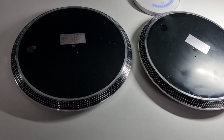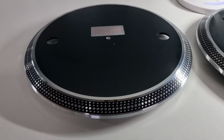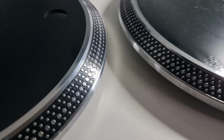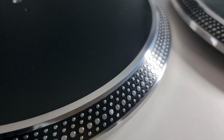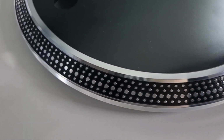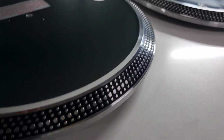I wouldn't recommend that anybody do that. All you're going to end up doing is putting yourself in the same boat as every other refurbished turntable that you find online, where you can see the strobe dots are obviously not, they're all flat and horrible. These are not, and you can quite clearly see that now by looking at the video. So a light mop, plenty of compound, hours and hours and hours of going over. That's the extent of what you get, guys.